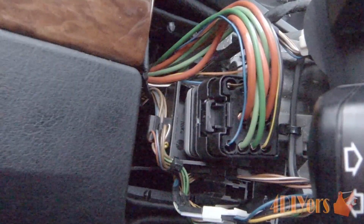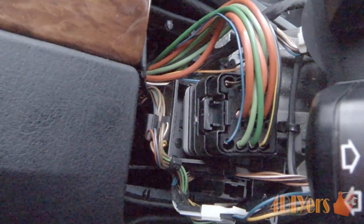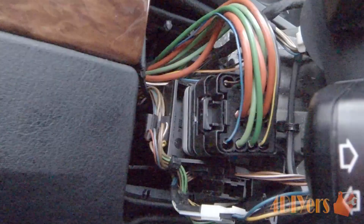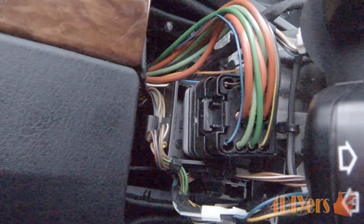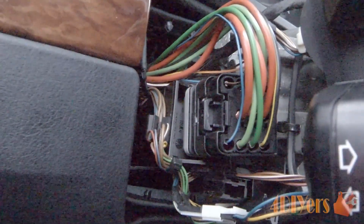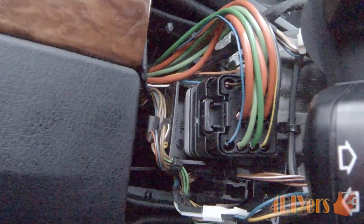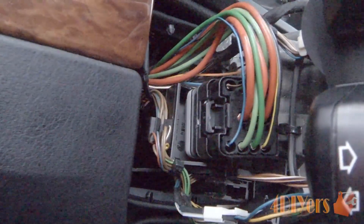There are quite a few different issues you can experience with a faulty ignition switch. With my vehicle, one of the faults I was having is when I would go to turn it over, I would just get a clicking noise from the starter, which was only activating the solenoid. I wasn't able to get the engine turned over. I went ahead and boosted my vehicle — it didn't make a difference. I made sure the battery was charged — same deal. The battery is fairly new, and the starter was replaced recently, so those weren't the issues. I also made sure the starter wires were tight and there weren't any blown fuses. After pinpointing the problem, I found out it was a faulty ignition switch.